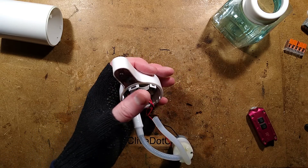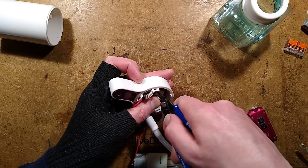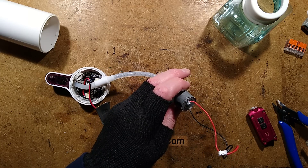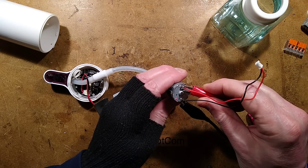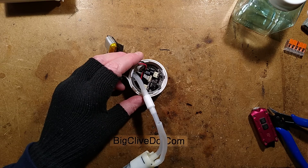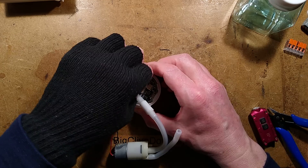The connector's not coming out - that's not so good. It's also good to know that the lithium cell can be upgraded if needs be. Has it been glued in? Mostly glued in. The bench power supply is set to about 3 volts. I shall put the black connection on here, since black is on there - and it's just schmooed all over my bench. What's the bet it works now and just gunked up? The schmoo has been cleaned up. Now what's the bet if I plug this back on here it would just work again?